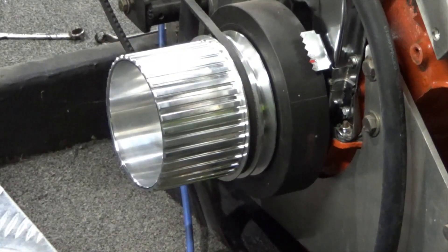I got the two bottom drive pulleys on. I put the belt on and looked at the belt alignment — it looks like the alternator is going to have to come back maybe about an eighth of an inch. Of course you buy stuff and it never fits exactly the way the old stuff did; you always have to change something.